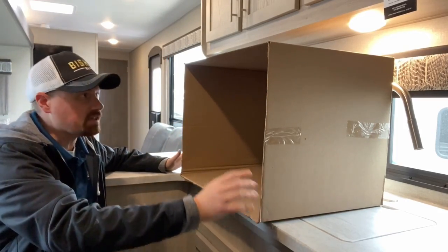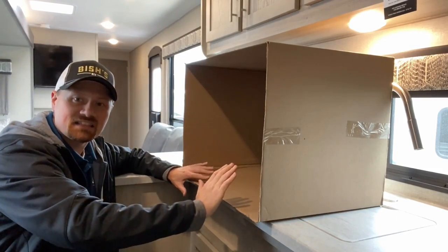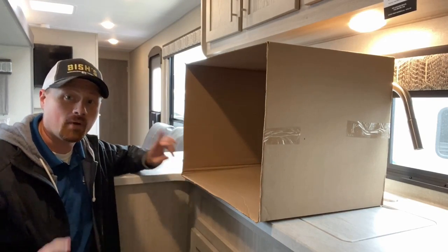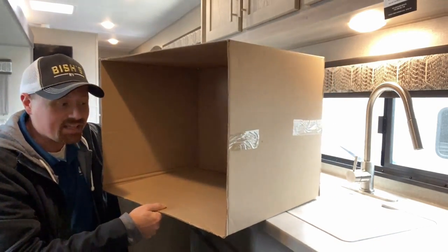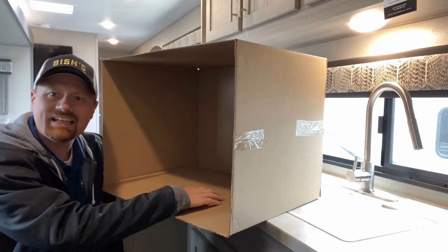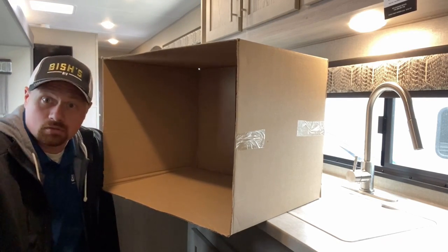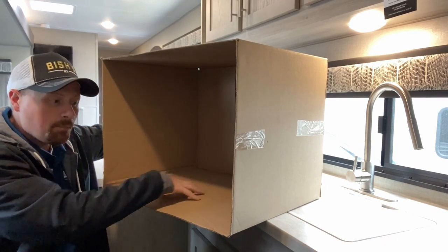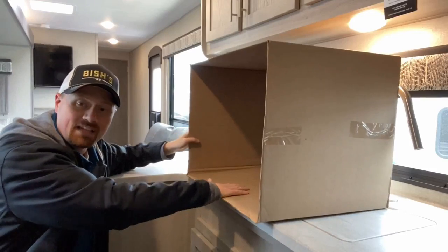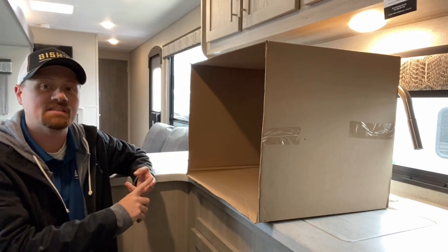Let's say this cardboard box represents a slide. It has a top, bottom, a back, and two sides, but it's open-faced on one side. When the slide is slid out, at the front inside lip of the slide box there's support — it's not going to go anywhere. However, when the slide is retracted inside the RV, slides don't generally rest on the floor because if they did, they would grind and tear up your linoleum. It's supposed to be just above the floor. Because of that, because it's not directly in contact with anything, if you put weight in it, suddenly look how it bows down. Whereas when it's out, it's supported. That is the reason why some slides you can occupy when retracted and some you can't.